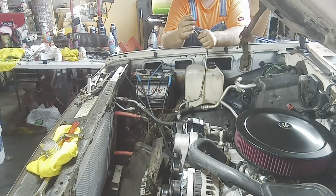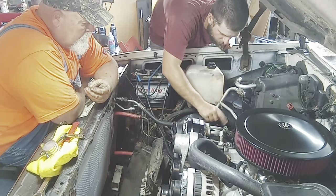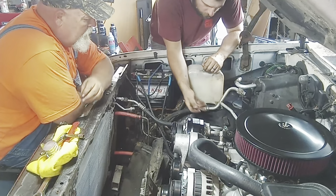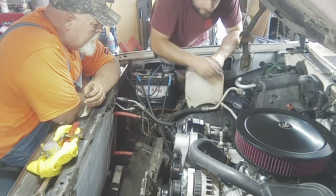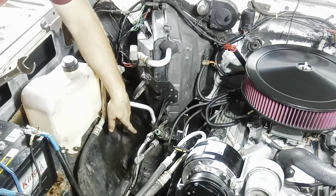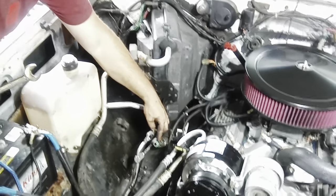All right. I just had to do all this and then have to go back and take every one of these loops. Just got to put a little bit of PAG oil. But that'll be good. Put this one on the very bottom. All right. That one goes there. We're just putting all the new green O-rings on between two kits that I have here from when I did my YCC. So we definitely need a bigger one here, Mike. So this is the one here that fought us, right there, right on the side of the high pressure side.